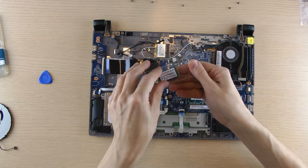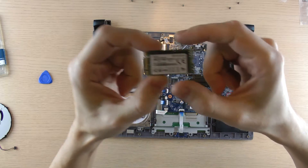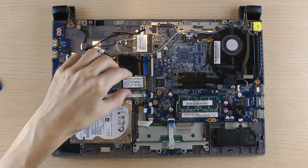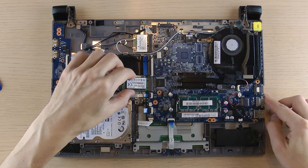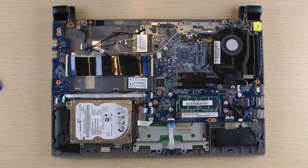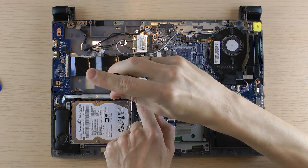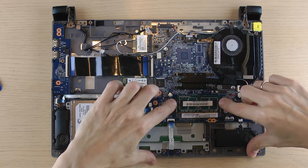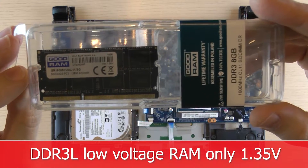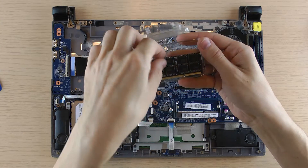I chose a Transcend 256 GB SSD with RAM cache buffer, but without SLC cache buffer. In this laptop model there is only one RAM slot, so I will change the 4 GB to an 8 GB module. Before you buy, make sure that the RAM is low voltage, as for older models there is regular DDR3 RAM. I will place links in the description for those or similar parts.